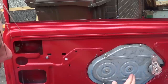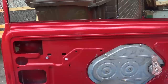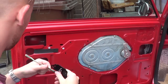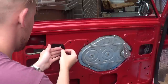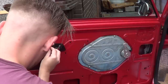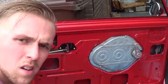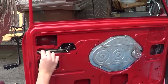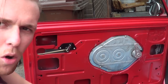I use the lagging tape around here to stop that rattling — that'll be tightened up when the door card's on. So I'll run a bit of this on and then we'll be on the way with the locks. The next thing is to run a strip across there, and as you can see, when we're driving there'll be no rattle. That should eliminate all rattle.